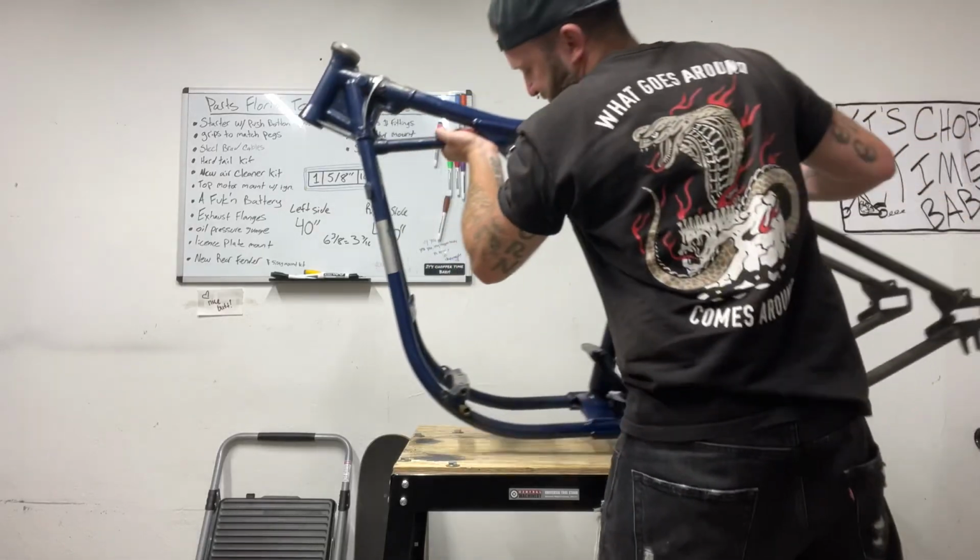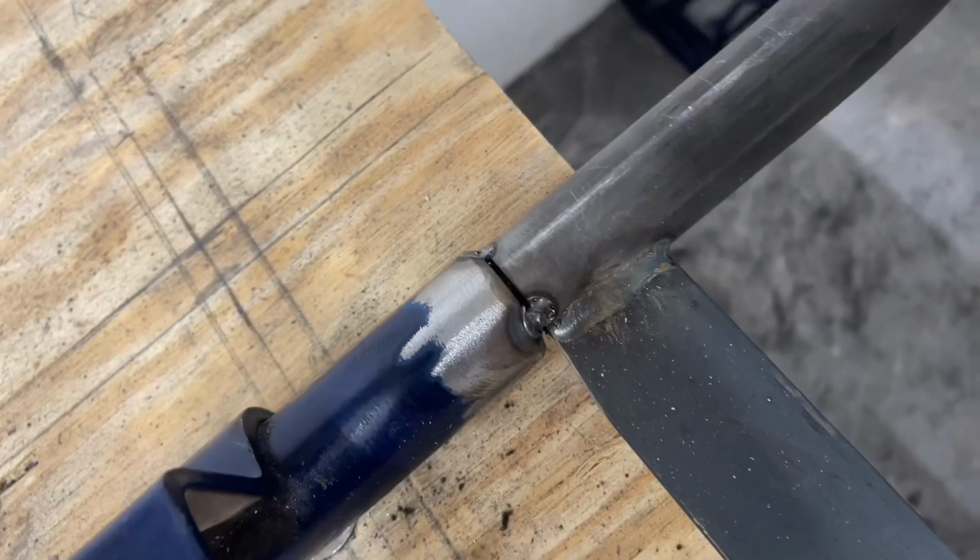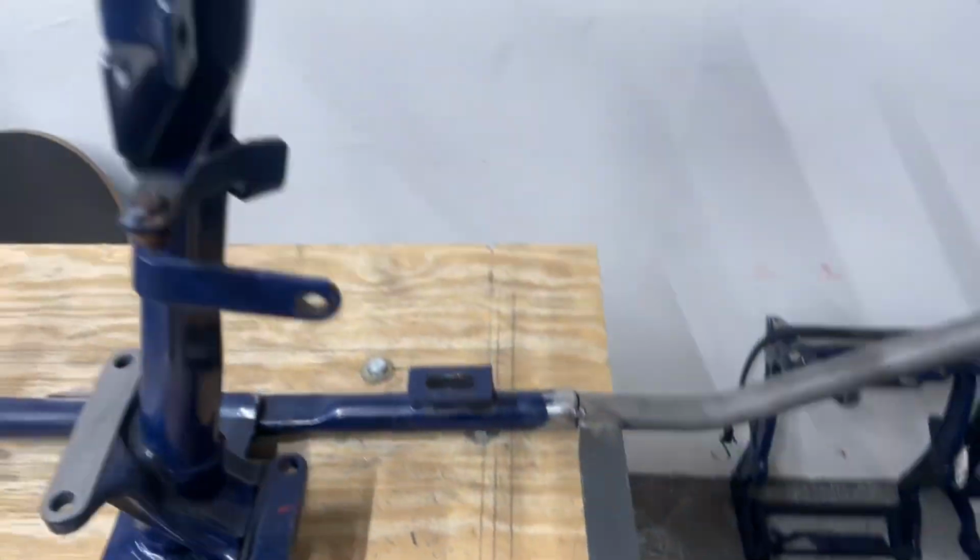All right, enough messing around. So we have each connecting piece drilled, slugged, welded. We have 3 tacks around each of the 4 mounting points. Got our space there. Tacks all around here. So this welder is limited, and that's why I'm taking it to a professional shop for them to either TIG or MIG, whichever one they feel comfortable with would be a stronger penetration. And once we get the frame back, hopefully this bad boy will maybe be a roller by next week.